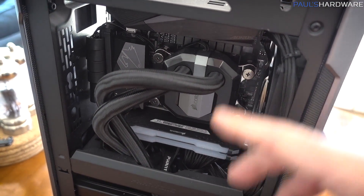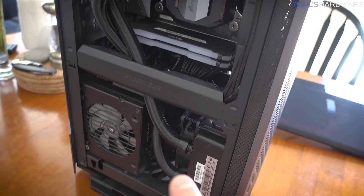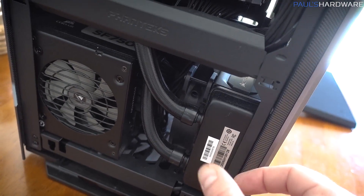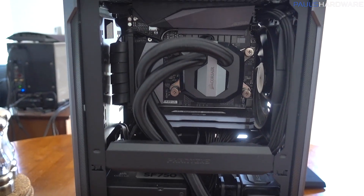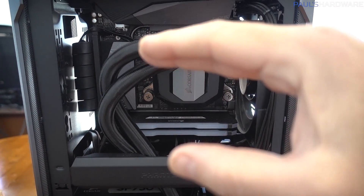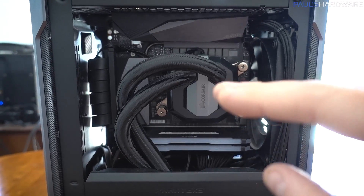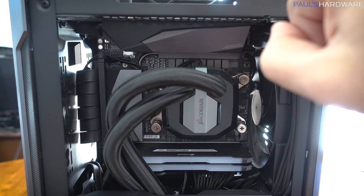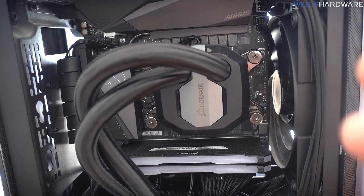You can fit CPU air coolers in this case, which is fine — they're a little bit height limited, but there's decent space. If you want to go with an AIO like this one, though, there's really limited space where you can put the radiator, and you kind of have to plop it down here. This is a Corsair H80i V2. Anyone who has watched the Gamers Nexus or Jay's Two Cents videos on this subject knows that keeping your AIO pump block at the top of your loop is not the best configuration. Generally speaking, you want something higher up than the pump block — usually the radiator — so that air bubbles accumulate there rather than in the pump block itself.